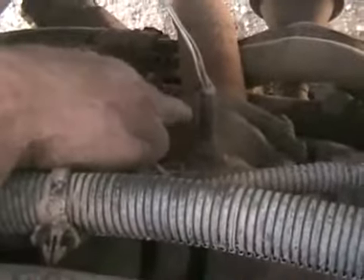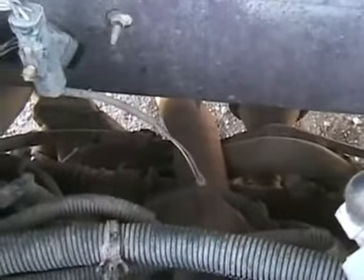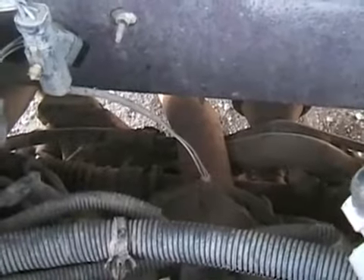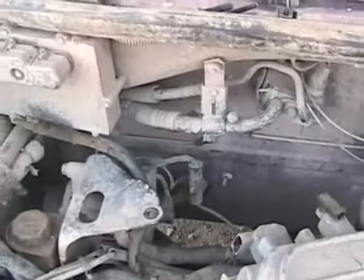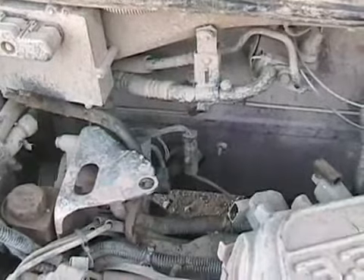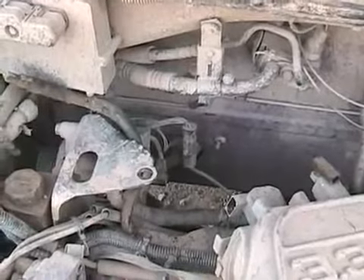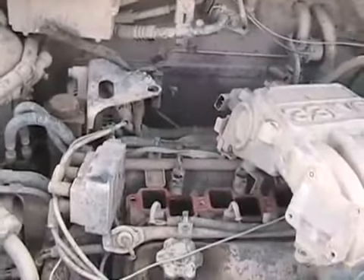There's a wire that goes to the exhaust manifold, to a thing that looks just like a spark plug except it has skinny little wires on it, and the end that screws into the manifold kind of looks like a spark plug except it has no gaps — it has little flutes on it. There's one or two of these on the car. The oxygen sensor measures exactly how well the fuel is being burnt inside your engine by sensing the exhaust gases, and then adjusts everything to give you optimum performance and fuel economy.